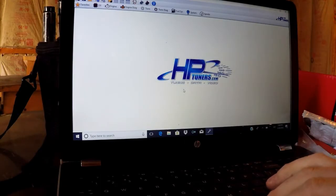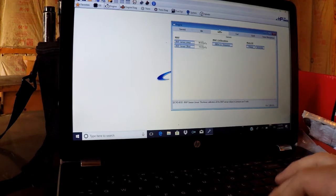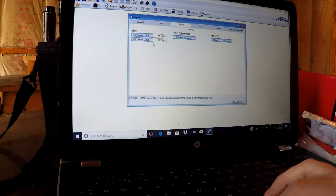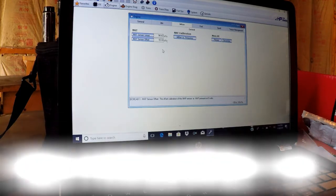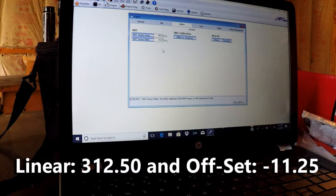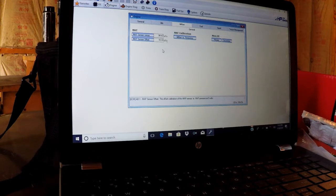So what I'm doing now is I'm going to go on HP Tuners and find where the map sensor adjustments are so I can set my scaling. If you click on the engine tab and then go to airflow, you'll see there is map sensor linear and map sensor offset. I actually went on a few different websites — I even went on Sloppy Mechanics Wiki where I get a lot of my information from, and honestly the settings on there were different from the website I got it off of. I'll post the website link in the description. On Sloppy Mechanics Wiki I think the linear offset for a 3-bar GM map is not for this map — I believe it's for the earlier generation maps. But we're going to see, because I'm going to set the first settings I got and we'll see if that lets the car start up.